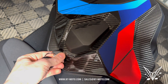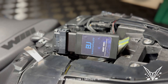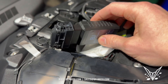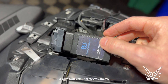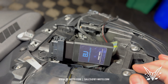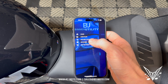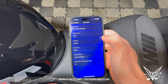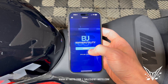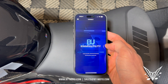As always you're going to have to take off your seat and get to your diagnostic port. It's easier if you have two hands but I have one recording. Once you pull off your seat, all you have to do is connect the Beamer Utility Tool to your onboard diagnostic port, your OBD port right there. On the BMW it's right there — super simple to get to. Then go through the connection process; if you guys didn't see my first video, check it out. Once you have the Beamer Utility app open, connect it, but before that make sure in the app settings you're always in e-net and always in Motorrad for the bike. Makes everything a lot easier, and connect to your Wi-Fi of course. Connect your Beamer Utility Tool with the dash on so the Beamer Utility is getting power.